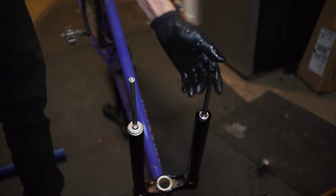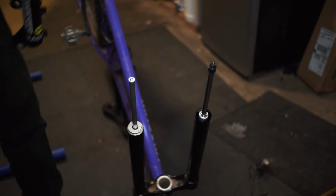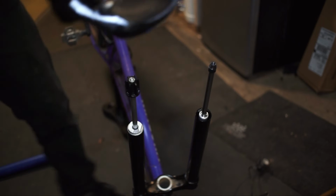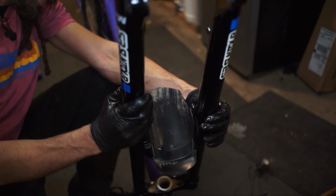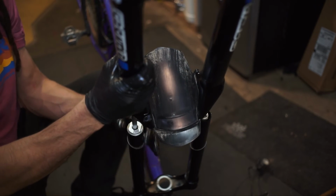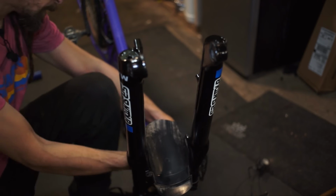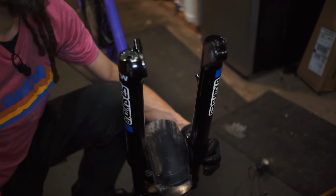I've got a pretty low ceiling in here, so it's a little easier to do this next part upside down. And you want to make sure you get all the pieces back on there, including this little guy. It goes on there right there, just like that. So now, we want to slide the fork back on. So I like to go ahead and just peel the Energizer rings off and let them slide up the fork. Insert it in, slide it up. Go ahead and reset your Energizer rings. And you'll probably need to put these fully back in place once you get it upside right.